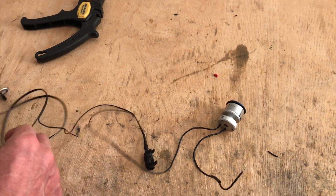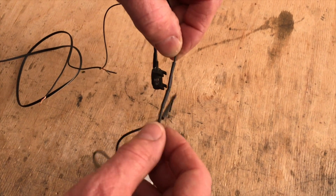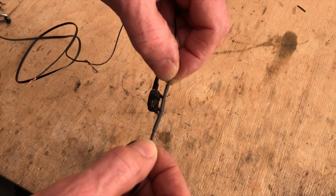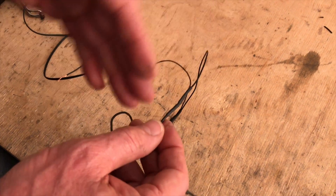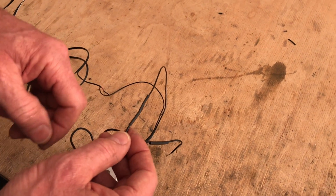The same can be done with a hot air gun or a hairdryer if necessary — even a lighter, but then you have to be very careful not to burn the tube and the cables. Now we have a permanent waterproof connection between the two wires. The same goes for the other ends of course. When you have the two cables connected like this, you really have a very reliable contact and a waterproof solution for decades to come — better than any plug. And in addition, you can adjust the cable length to the bike.